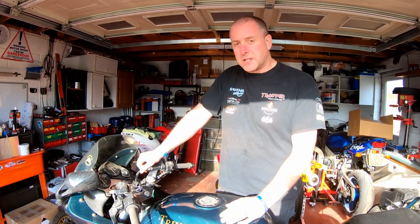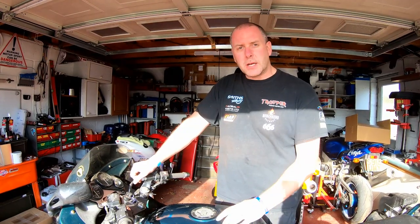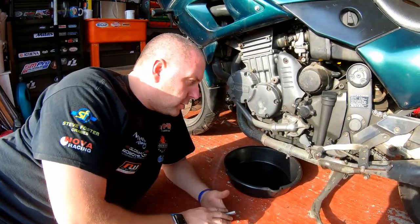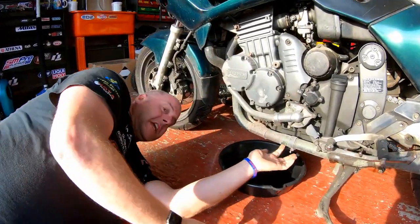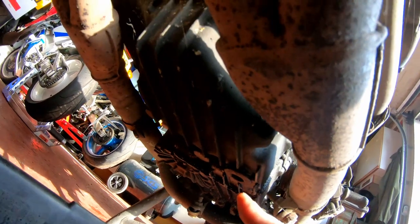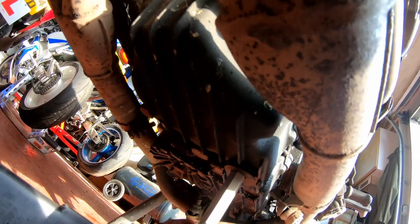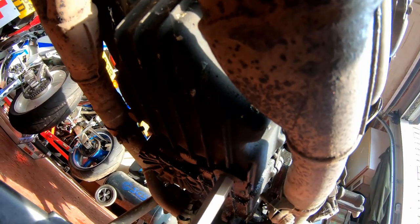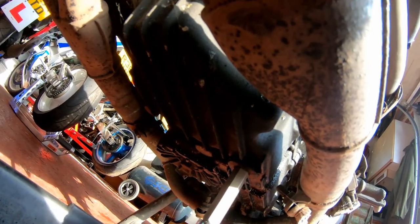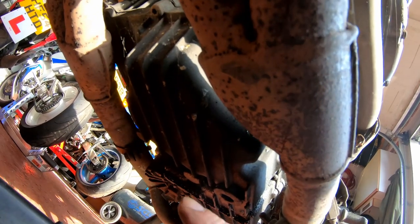Oil's up to temperature, so turn the engine off. What we need to do next is obviously drain the oil. I'll grab an oil pan and we'll head underneath the bike to have a look at where the drain plug is. In order to drain the oil, the sump plug is just under here — just there. This is a 12mm Allen, which is a pretty serious size. Not a lot of people will have these in a standard socket set, so you may need to invest in a 12mm Allen. That is the sump plug, so let's whip it out.